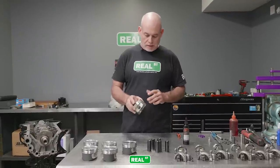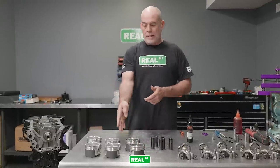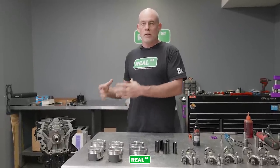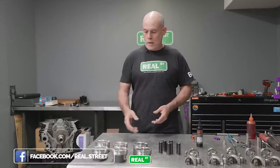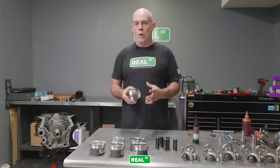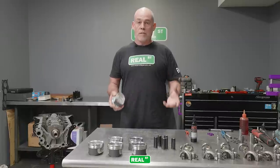One of the things you'll notice on these pistons is the coating on the skirt. This is the abradeable coating from Line to Line. We've put about three thousandths of an inch of coating on the skirts of the pistons. The reason is that it's an 86mm piston and the block had already been run, so we had to go over-bore slightly by three or four thousandths in order to get the bore straight and the right surface finish for the oil, rings, and everything to work well. But by then we had what I would consider excessive piston wall clearance. Having this coating done isn't real cheap — it's a few hundred bucks — but it's going to buy me back to the correct piston wall clearance. It also does a really nice job of retaining oil; it's a spongy, porous-looking coating under a microscope, and that's going to keep more oil on the bores, which helps with piston scuffing and ring seal.